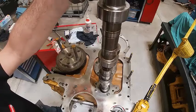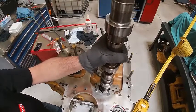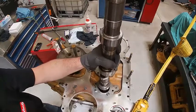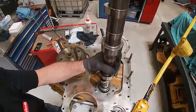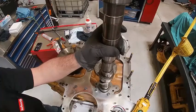I'm not seeing two bad ones — well, right there, that one's pretty bad too. So like I said, this engine would be due for a camshaft. You have to just be patient with this when you do this, because it hangs up on the lobe as you go in. See there, it hung up on me, so I've got to turn it and get it to line up.